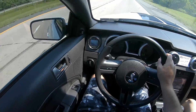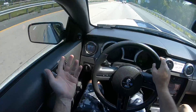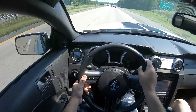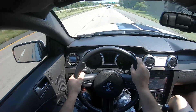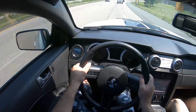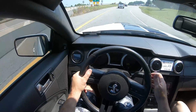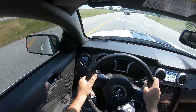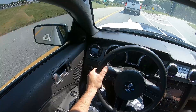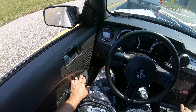So far I'm going to give this a no. You can see IAT-1 is 100 degrees right now, IAT-2 is about 122, and we're cruising about 70 miles an hour. That's pretty much what it's normally like when it's 100 ambient — I would say it's normally in the low 120s to about 125. So far, this stuff has done pretty much absolutely nothing. But I'm only out 10 bucks to find that out. The temperature did go up quite a bit — it's got to be 90 degrees at this point.